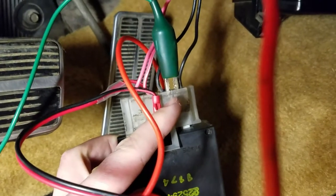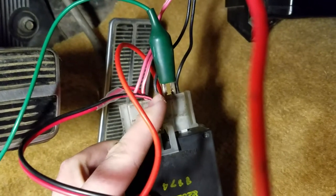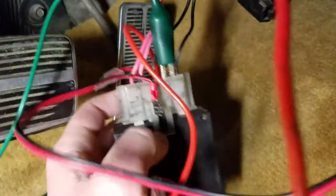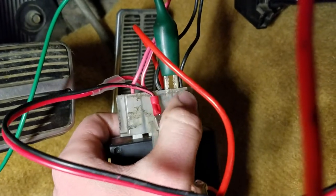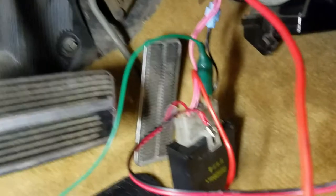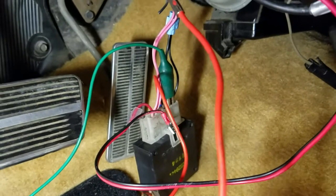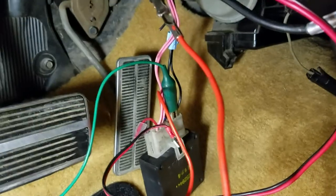The last black wire is your seat belt ground. So when you have the seat belt unplugged, it is a continuous circuit — basically grounding those two black wires together — and that's what causes your buzzer to chime or buzz. When you plug your seat belt in, it breaks that ground and your light will still come on on your dash, but it will not buzz.